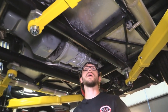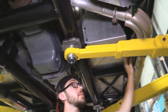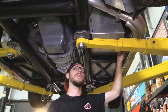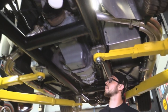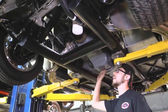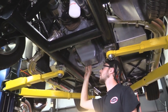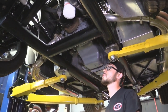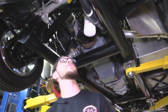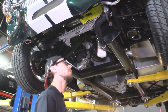New brake lines run all the way up forward. The body on this Cobra is actually carbon fiber — not the typical fiberglass body — saving roughly 75 pounds, which makes it even faster. For Ford aficionados, this has the later model pan, which implies it's a later model engine, and the casting number confirms it. This is a roller block — you don't have to worry about any flat tappet cam failures. Moving forward we have a Motorcraft FL1A — a good oil filter choice.